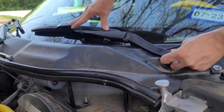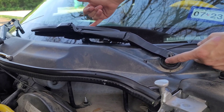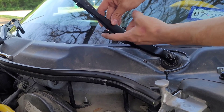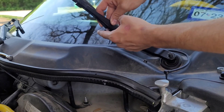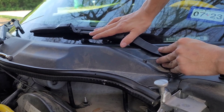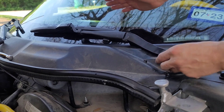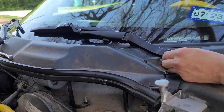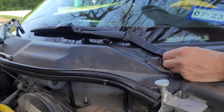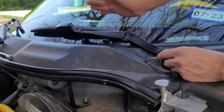When installing the wiper arm later, make sure your wiper blade is right on par or just underneath what GM calls the black void. There's a small black piece here — for my vehicle it's directly in line with the border at the bottom of the windshield, and that's what I'll use to measure placement. You don't want it too far down or you'll clash the air inlet, and not too far over or it'll go off the side of the window. Find your identifier to get it on correctly.